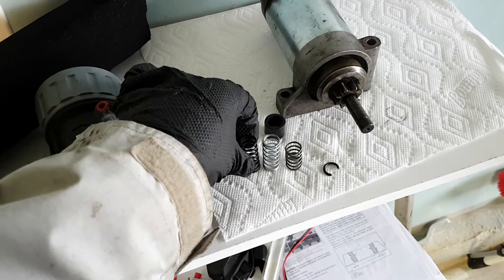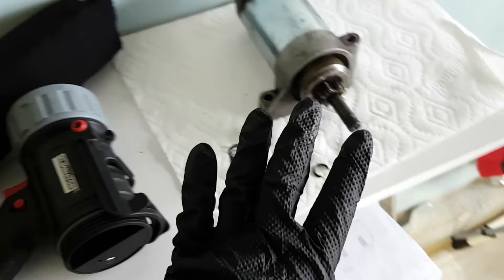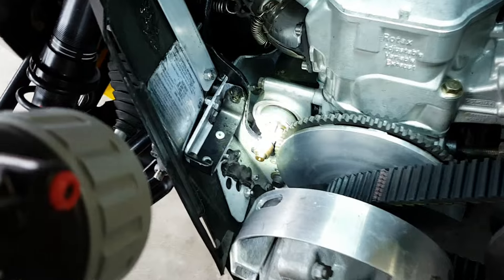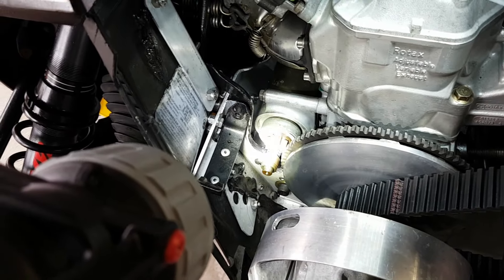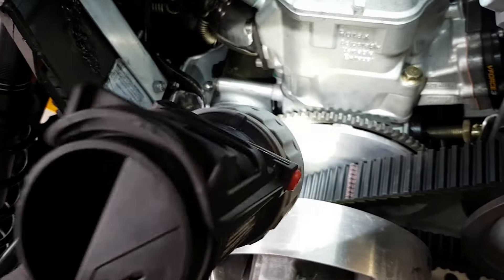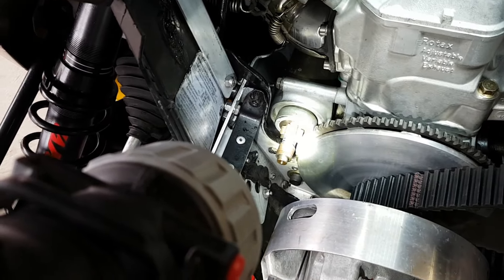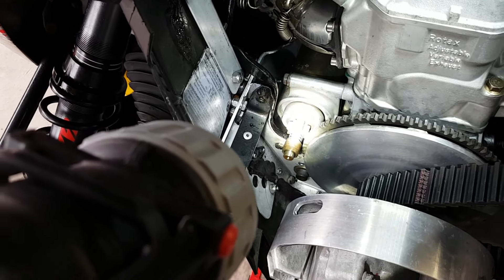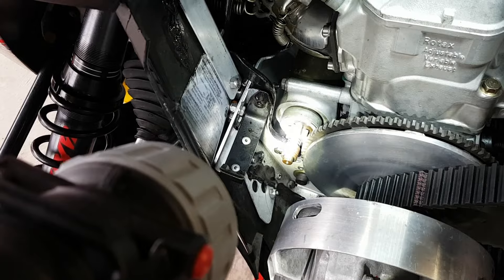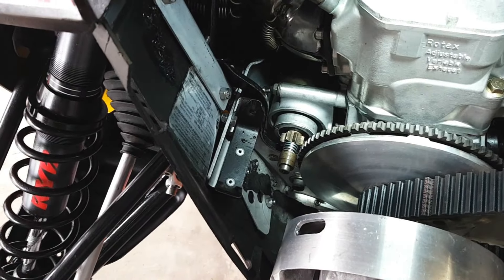I thought if I was putting it on that starter it might fit because they're comparable in size, but on the starter I had, I thought no, it's not going to work. Thankfully when I got it on, it does work. Initially the Bendix came out and stuck — I hit the start button just to try it out but I did not have the primary clutch on, so it overextended and went too far. If you've got the primary on, which you should, and then you try and start it, the spring doesn't overextend, doesn't bind up. It works perfectly well — everything goes swimmingly.